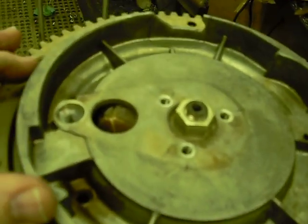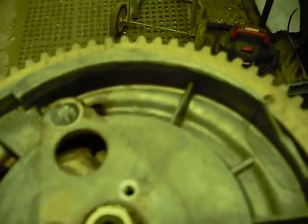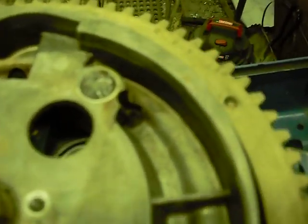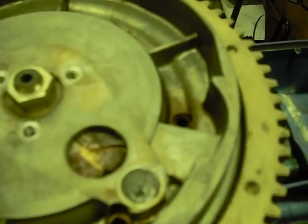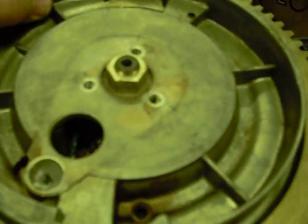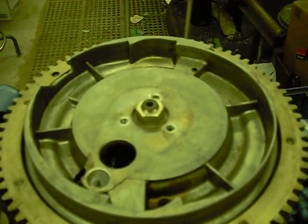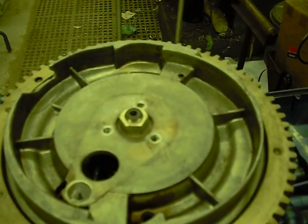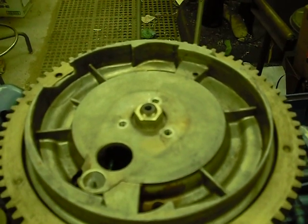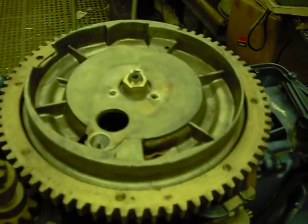You can see the old red paper-top condenser in there. It's not focusing very well but you can see that coil in there is nasty - cracks, big pieces broken out. That's an original 50s OMC coil. Another condenser paper-top and another broken coil, so it's still got the original ignition in it. As counterintuitive as it may sound, I really do like to find them that way - it means nobody's been into it and done anything bad. It's always nice to find them original.